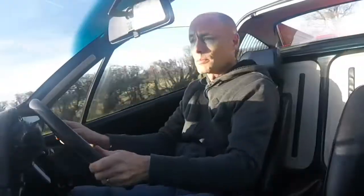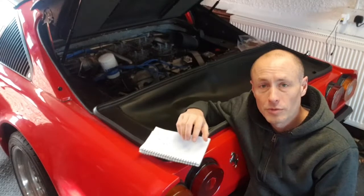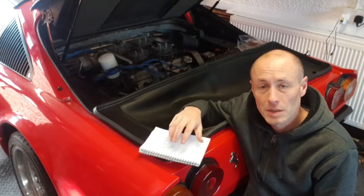Get her back into the garage and re-perform the compression test. Once I've done that, then I can actually start stripping those carburetors. Still a little bit nervous about doing that because I've not worked on Weber carbs before, but what's the worst that can happen? Back in the garage and with a warm engine, I've re-performed the compression tests.